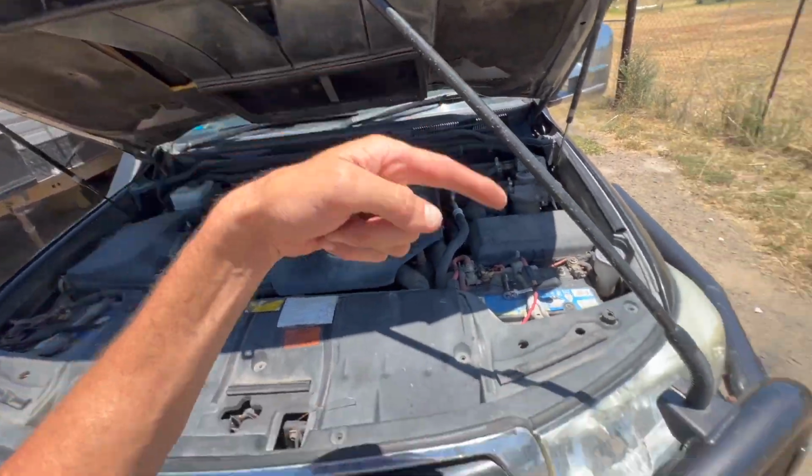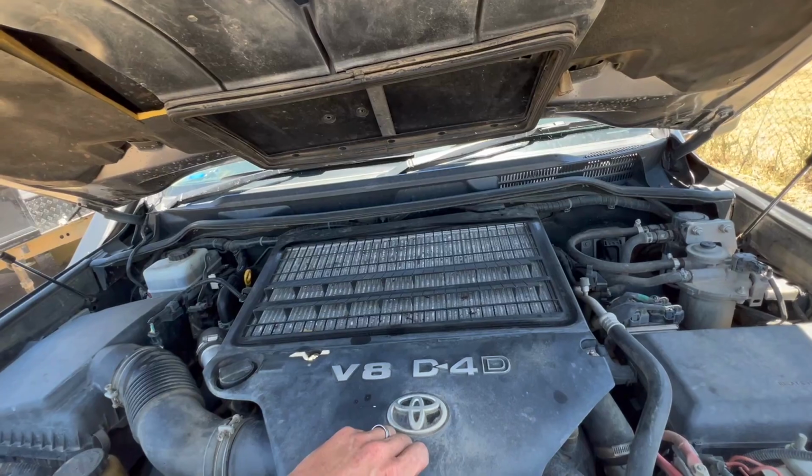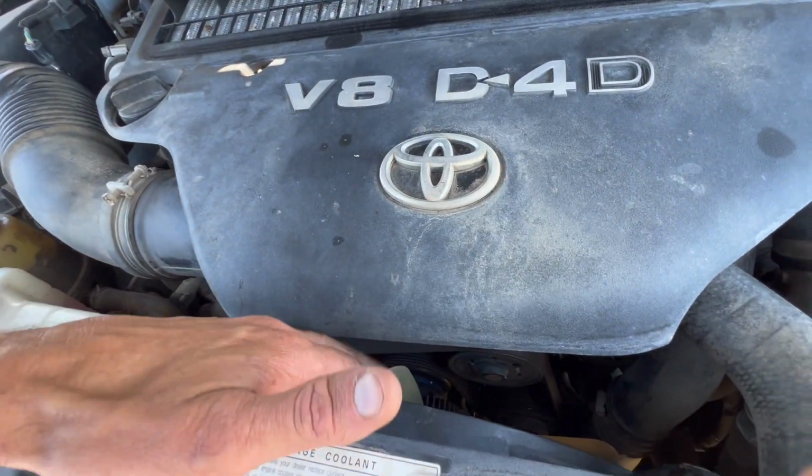Now we'll slip under the bonnet real quick and we'll have a look, eh? As I said, it's got 400,000 Ks on it and the gas struts are buggered, and I use the aerial to hold the bonnet up. Don't judge me, copy? What my thoughts are is with the viscous fan hub, I've actually got to pull it apart now, and I'm going to get a syringe and suck 18 mils of oil out of it. So that means that it'll be back to the 4 vials that the viscous fan hub needs to run correctly and properly and smoothly and everything like that.